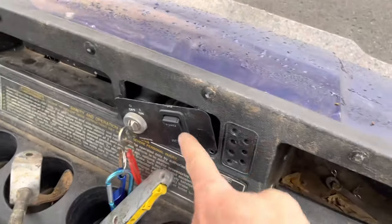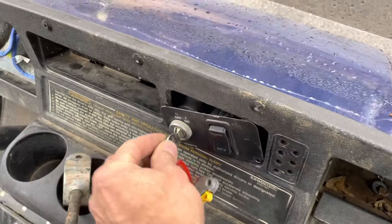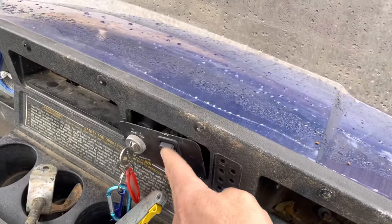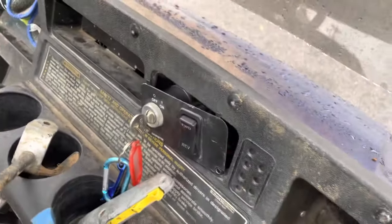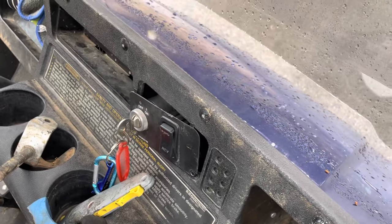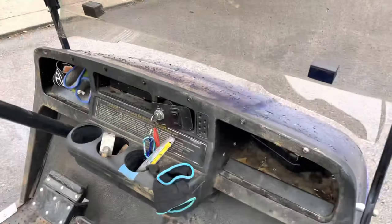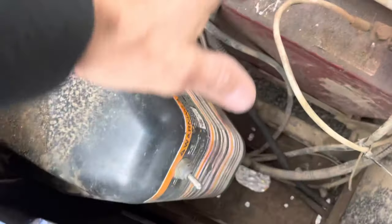And then this is in the neutral position and the key is off. So off, neutral position. Make sure that your buzzer actually works, because for programming, that buzzer is going to tell you what the right program is. That's the type of sound that you'll get. But anyway, you open the seat up and there's the speed controller right here and your on/off switch